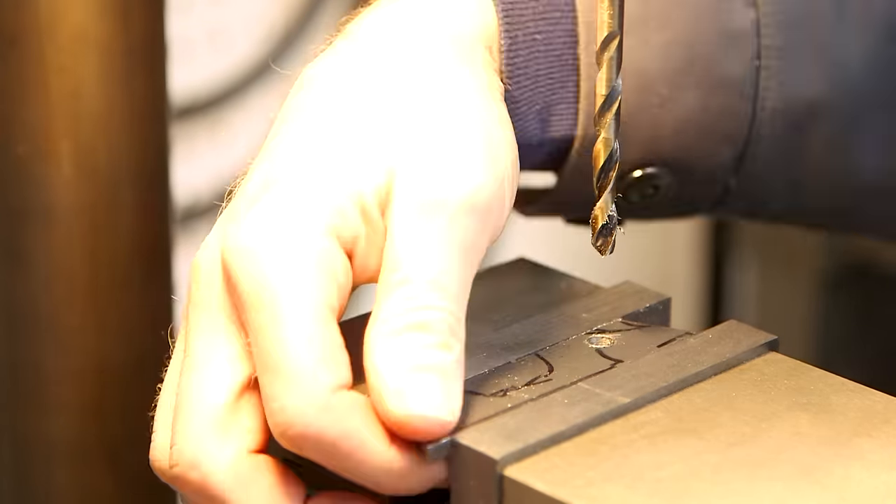That's how it turned out — it's in exactly the right place for the ISO standard 40mm and 78mm center-to-center dimensions. I added some spacers between the bracket and the mount to move it outward so it lines up with the center of the dropout. I've got the brake mount sitting exactly where I want it. I'm going to put a couple of tack welds in while everything's together to make sure it's properly aligned. I've added cardboard to keep weld spatter off the wheel and tire. There's a braze joint right here, and if I run a weld through that it will vaporize the brass and ruin the dropout. So I've added a vice grip to act as a heat sink, then I'll tack weld here and here before fully welding.